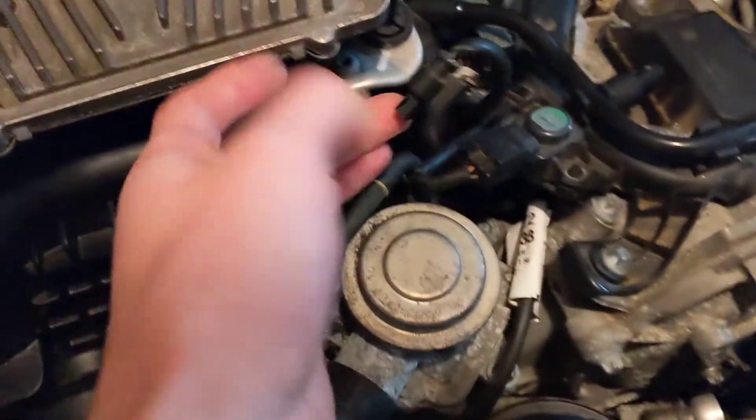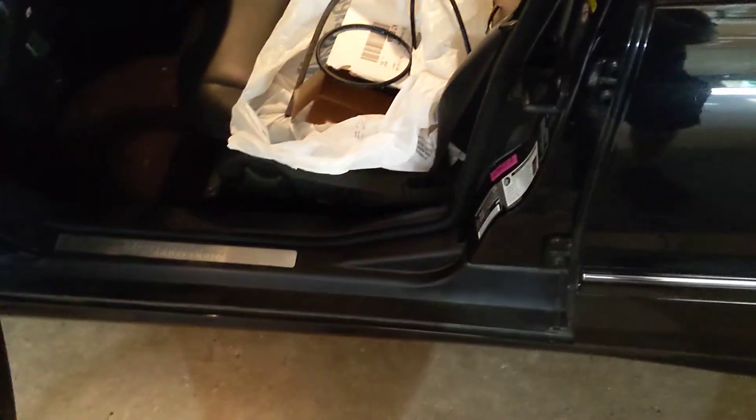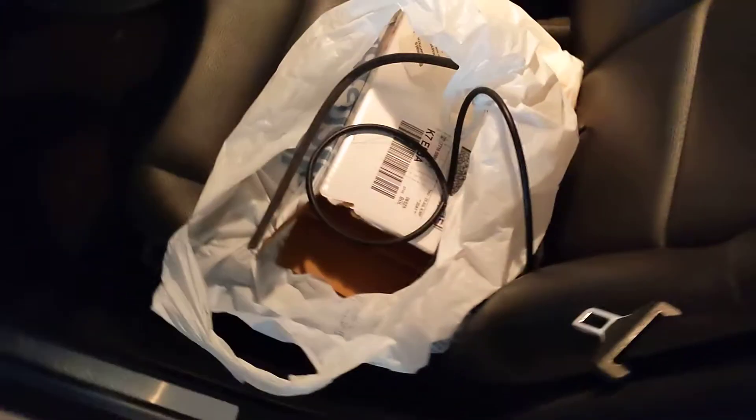I had touched on how I have these sensors hanging loose that were originally for the intake manifold runner flaps on the old manifold. I did learn that in most cars that's going to throw a code. It seems like in the larger displacement M272s some people can get away with that and not get a code, and the car runs great. Just because I'm a little nervous about it, we decided to go a different route.